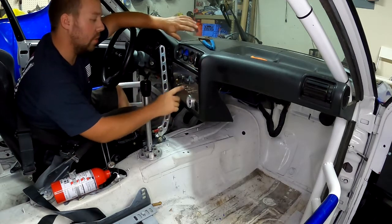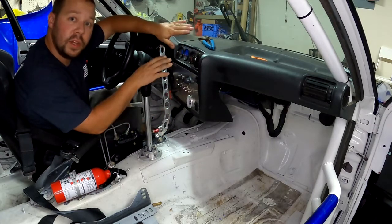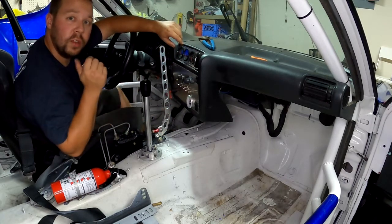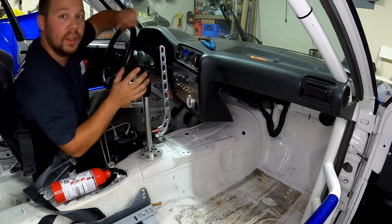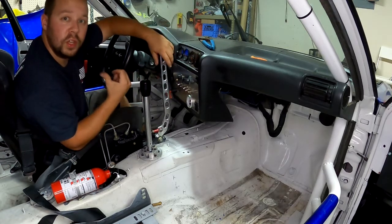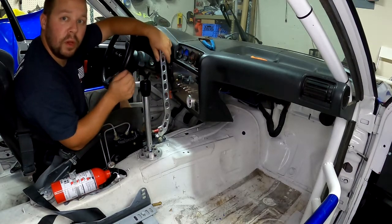Alright, so now we have all of our electrical done. We have our main power with our inline fuse that runs to the switch. The switch will then feed power to the pump inside the cooler, and we do have the cooler grounded to the battery as well. So all of our electrical is done. Now I should probably go ahead and test it, but I'm sure it's going to be just fine. So from here, the next thing we're going to do is run our water lines from the cooler out towards the driver's side. I'm going to leave some extra slack in there, then pour some water inside the cooler, hook up our main connector, and just flip the switch and make sure the pump is working.